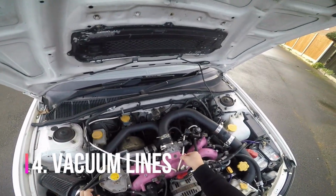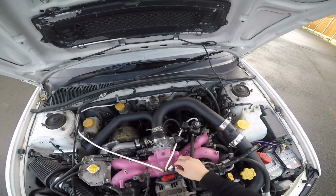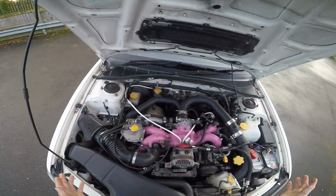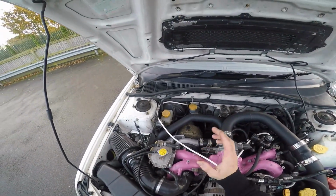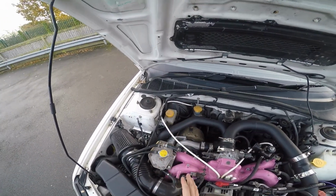And all of these vacuum lines that are on the twin turbo system have all got numbers on them. You've got like a hose 10 mod that's down here. They're all labeled up like 1 to 20 or something. But yeah, don't take them out. These look better. They really do look nice. But because of the numbers, when people change them out, you can't always identify where they're going or where they've come from.